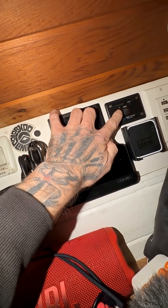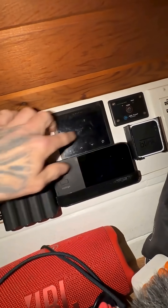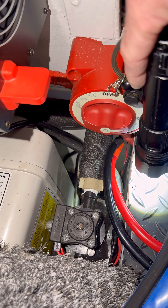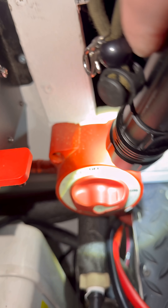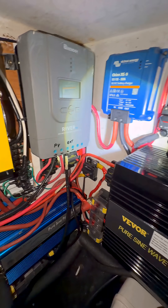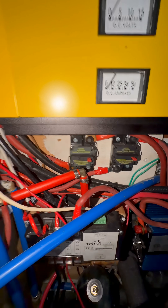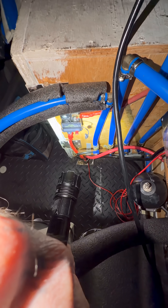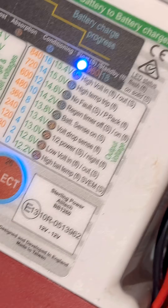Normally my inverter would be on right here. Down here under the black diamond mat are my batteries. Right here is the kill switch for the batteries, and that's what powers all the electronics. I noticed that all my breakers were in the normal position right here. I don't have any power to anything, but I have a power wire coming out of the floor going to this breaker right here, which is giving power to this.